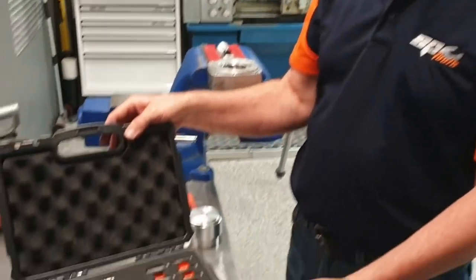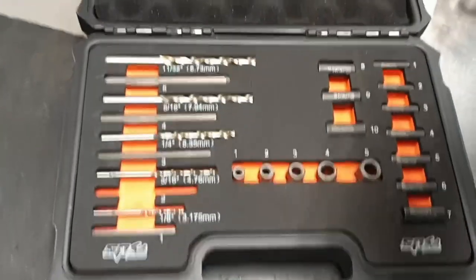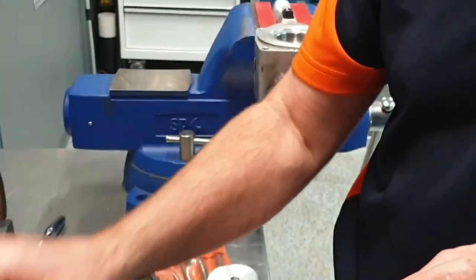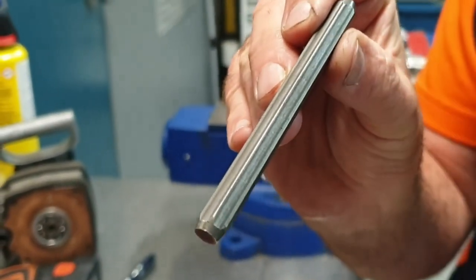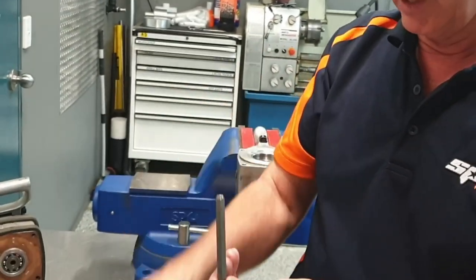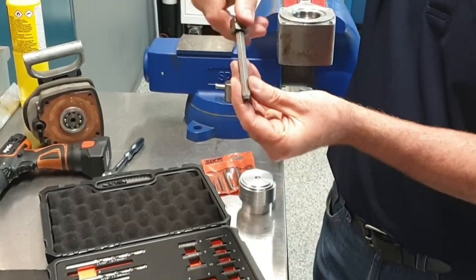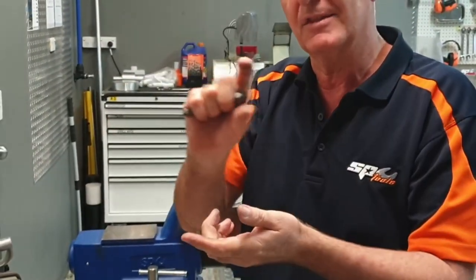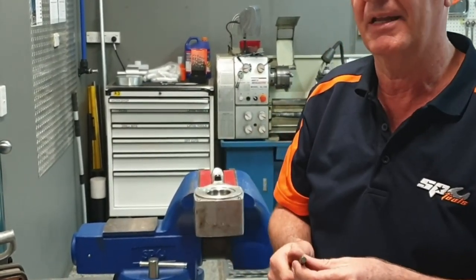This kit, which is a 25-piece kit from SP, gives us the ability to use these hexagonal fluted drive rods. You can see the flutes on the edge — we drill a hole and force this all the way down the whole length of the stud if need be, then put on a drive nut and undo that bolt with a normal socket. The benefit is that we're driving on six points the whole length of the stud left in the housing, so the chances of it slipping are very slight and the chances of getting that stud out are very high.